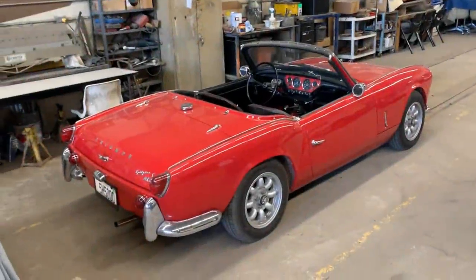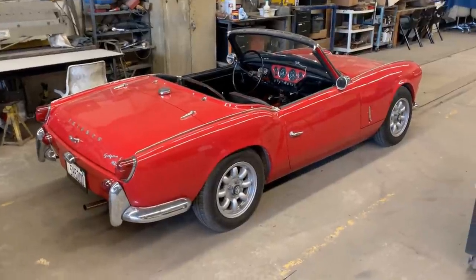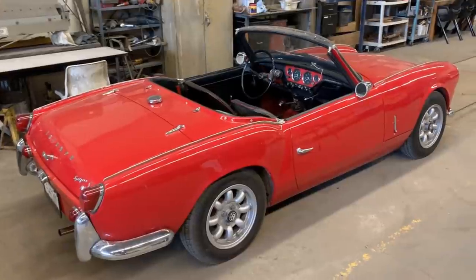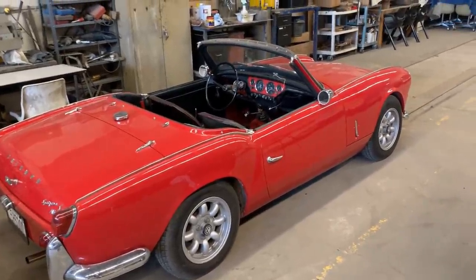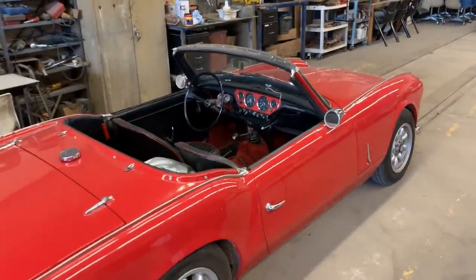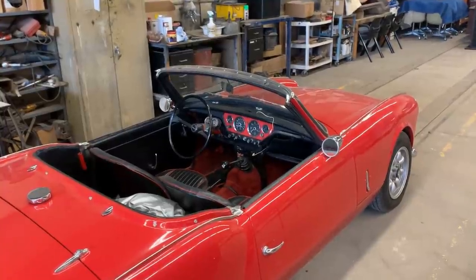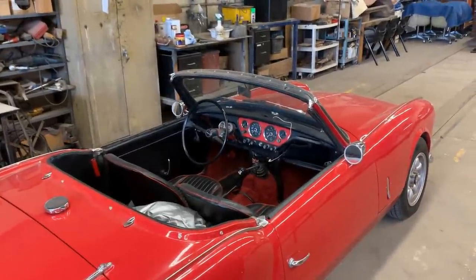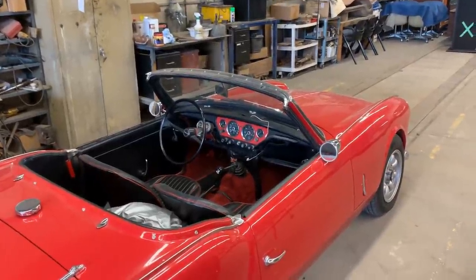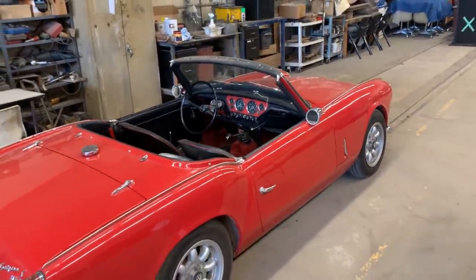So like I said, she has a little issue, and before we put her in the storage for the winter, we need to fix it. So in the spring, we are ready to start driving. So the problem is with the clutch, and I'm not really sure what's going on. I'm assuming it's either the clutch plate or the slave cylinder, maybe. I don't know, because the pedal seems normal, it's not spongy or anything, but she doesn't disengage. I'm grinding gears like crazy, and once I start going, she's going.